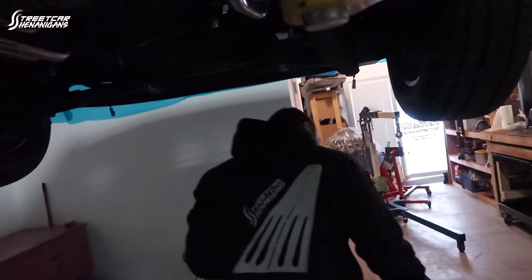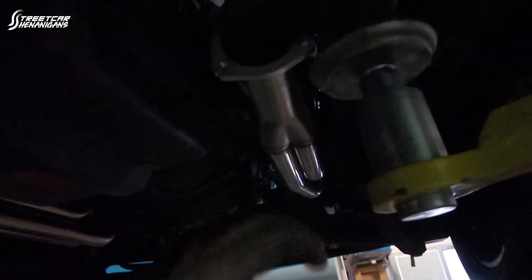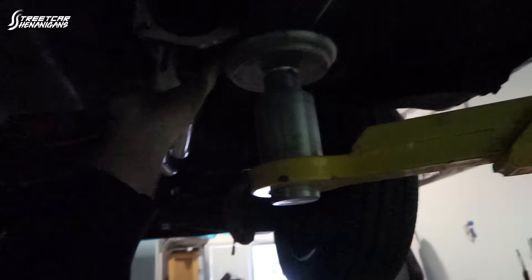The Cook's headers come with a three-bolt flange, so we're going to order the collector to start building the rest of the exhaust once everything else is pretty much done. We're going to do an exhaust very similar to the red car — it sounds wicked. One primary is right on the frame rail, so we're going to tweak it over — only about an eighth of an inch, but that's enough to cause a vibration.